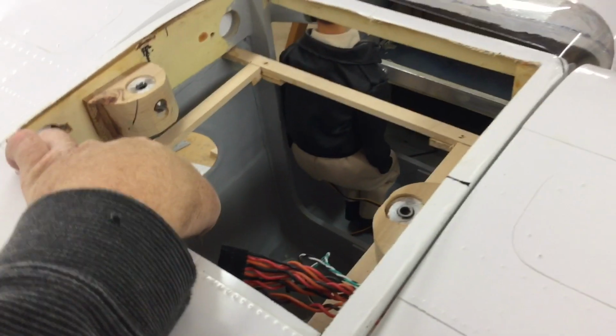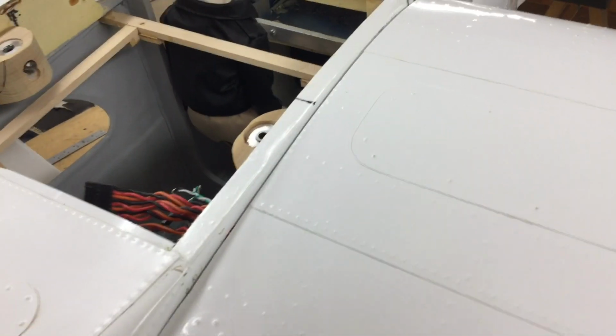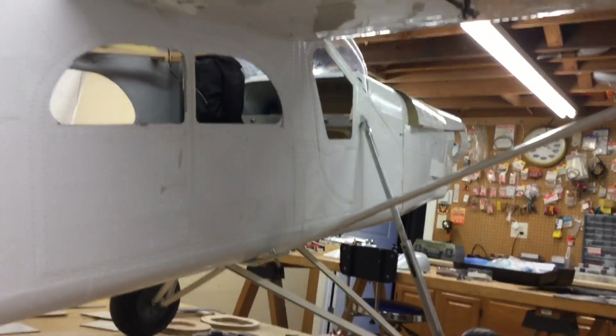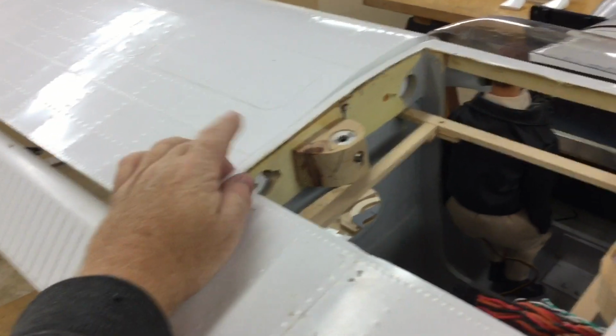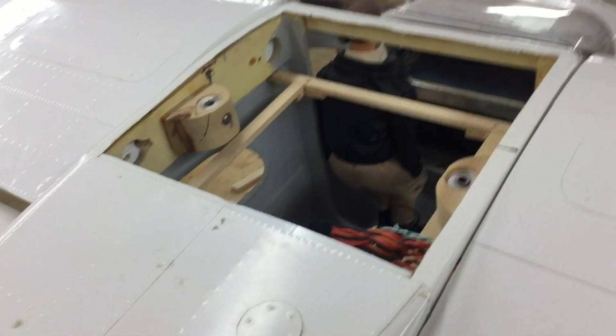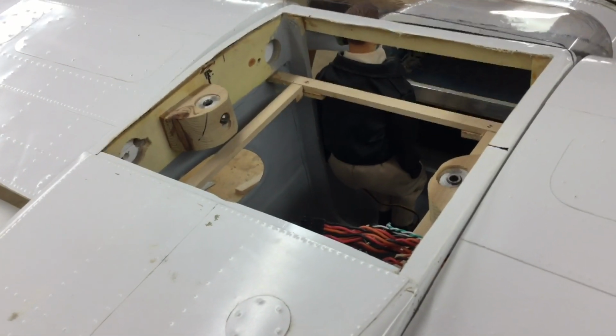Didn't know what these holes were for, a wing tube or something, but I found out that that's not a wing tube. It doesn't have a wing tube. Pretty much this bolt and the strut hold the wing on. There's going to have to be some anti-rotating pin put in here, maybe a bolt here, to hold the wing on. That's where buying secondhand and not having a manual, you have to be the engineer and designer to make sure this thing's not going to fall apart.